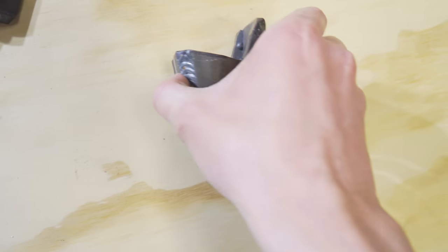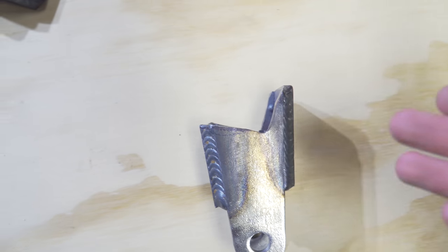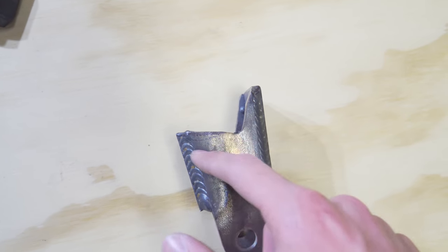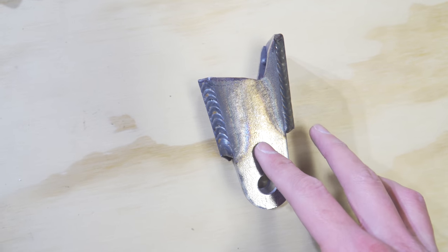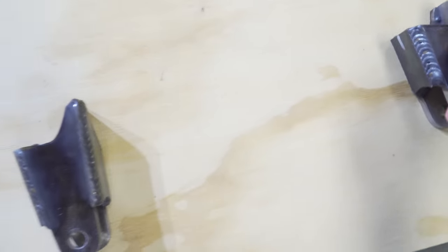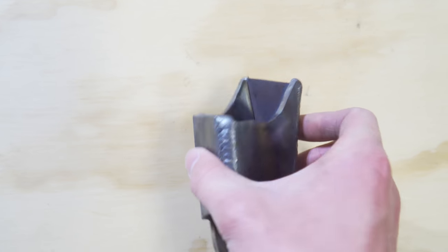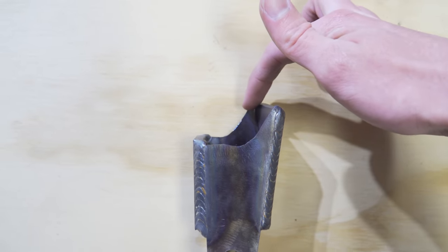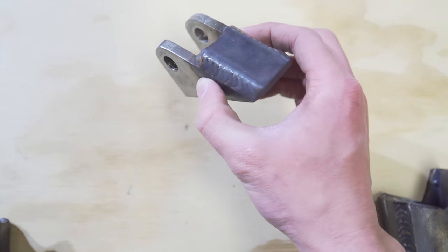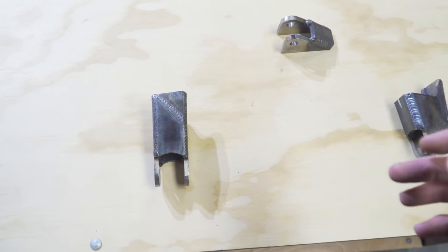Here's the mount we've been making — you can see it still has that L-notch in it, but the issue I ran into is that it wouldn't fit to the frame nicely. The frame has more of a kickout than I thought, so when you hold this straight and in-line with the tie rod there's such a big gap that no amount of trimming would fix it. So I put some pieces of foam board on here, laid it over the top, notched it correctly to get the pattern, then transferred that to new pieces and had Christian weld it up. You can see he did a really nice job — there's much more material here to sit level on the frame. Here's the one that goes on the tie rod itself — Christian again did a great job welding this up. These pieces are going on hold for now while we move to setting the steering stop and getting the box marked.